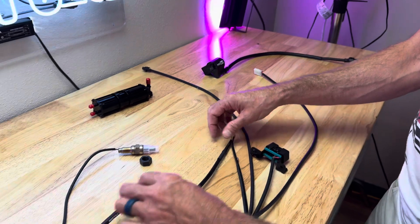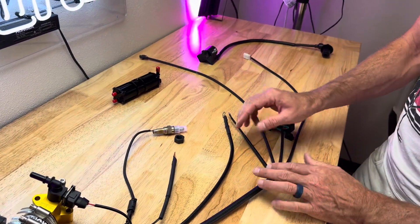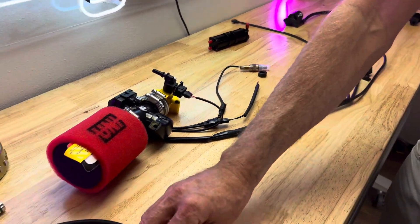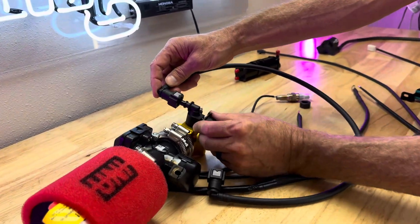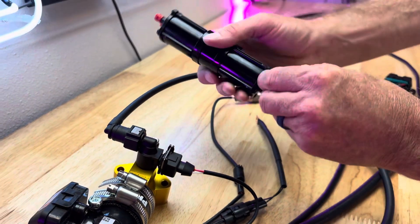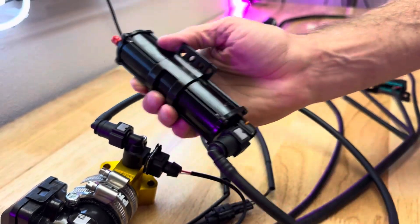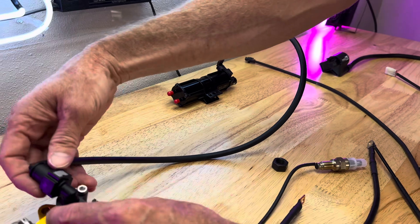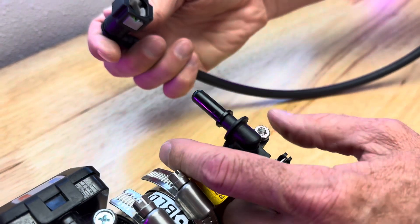So that's the complete install — it's very easy. In a nutshell, you just have four wires to plug in and that's it. It'll plug into any wiring harness. Next, we've got our fuel pump hose — it's our fuel injector hose. All you do is just plug this in like this. That clips in there. You take your fuel pump — that'll clip in right here. There's our fuel hose. It's all high pressure, 42 psi hose. If you for some reason need to get this released from here, you're going to push this down and pull open.